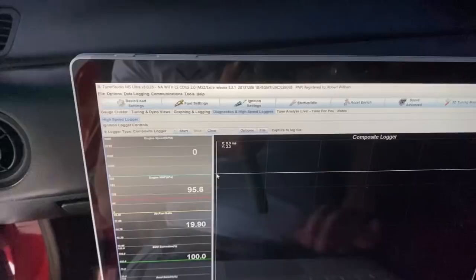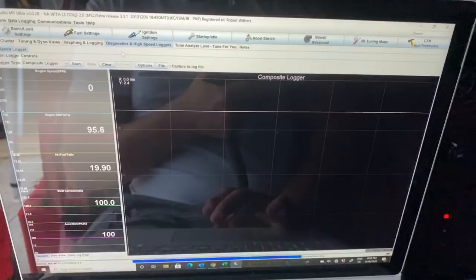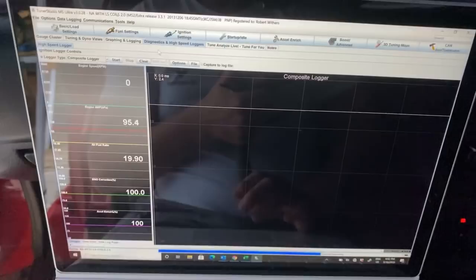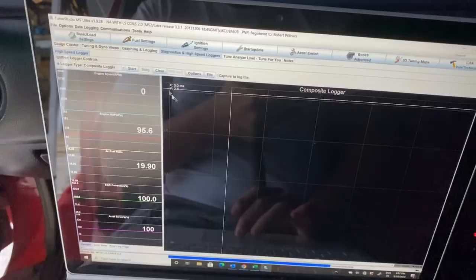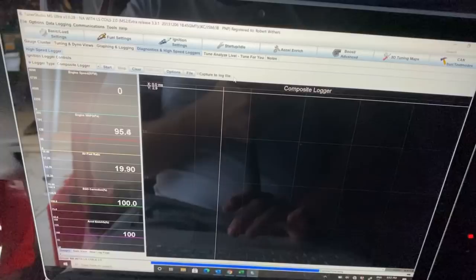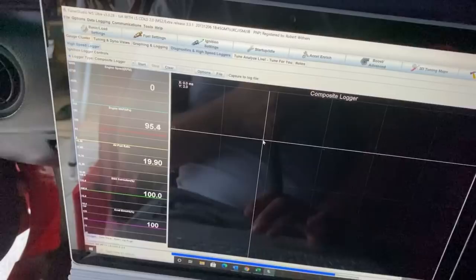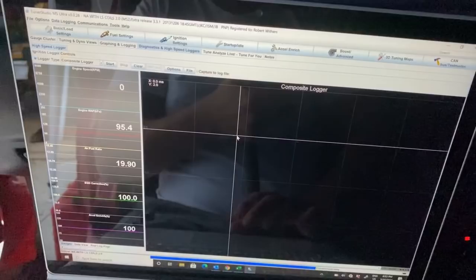This car was having issues with ignition dropping out under boost with heat at Sydney Motorsport Park a couple of months ago. I bought a set of LS1 coils, put them in, and instead of paying a tuner I just updated the settings myself. I added about 5% more fuel into the VE table, then datalogged to make sure we were still meeting AFR targets. A little bit of fine-tuning here and there, but it's relatively simple stuff that's really nice to be able to do yourself.